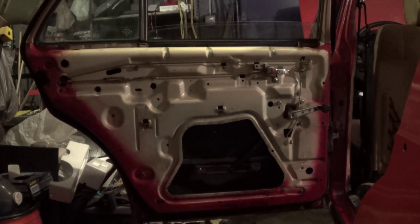That actually didn't take long at all — probably spent maybe 15-20 minutes tops. I changed out the vacuum element and I removed, re-greased, and reinstalled the window regulator. Turns out the rear window regulators are a lot easier to deal with than the fronts. The window's moving a little bit smoother now, but the rear one on this side actually wasn't too bad, so it's a slight improvement where improvement wasn't even all that necessary.